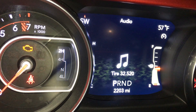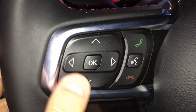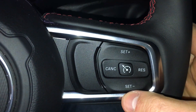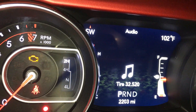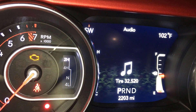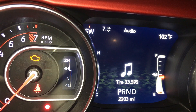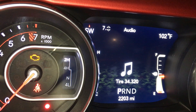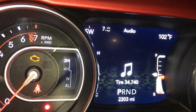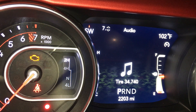The anti-lock brake system to work right — all this ties into your tire size. In order to adjust your tire size, hold the left arrow on your steering wheel and then go up and down plus and minus with your cruise control adjustment keys. Since the Milestar Patagonias we're running are 315/70R17s, I looked up on the website their specs for their overall diameter, which is 34.7. So we'll just adjust in these decimal increments as close as we can get to 34.7. And now you've adjusted your tire size.